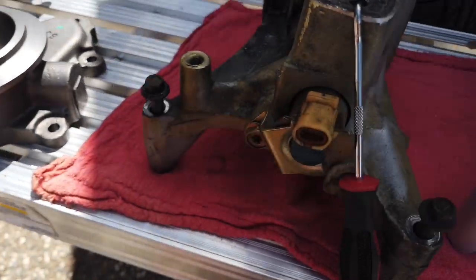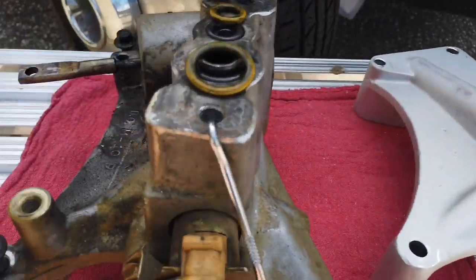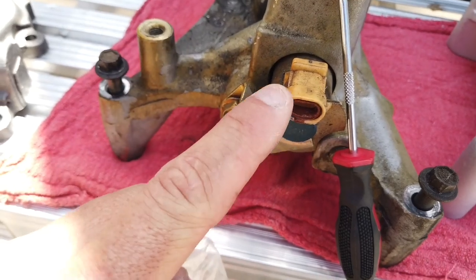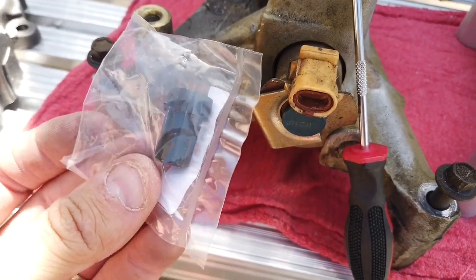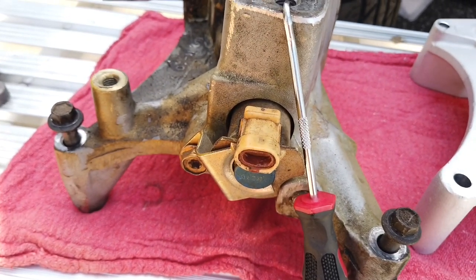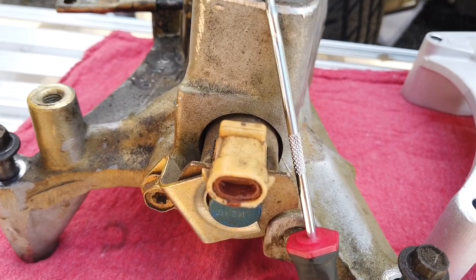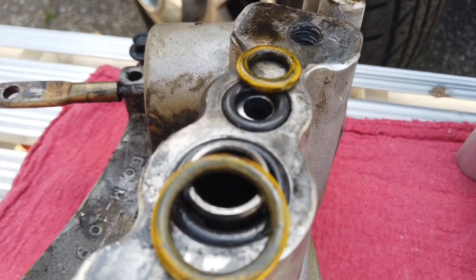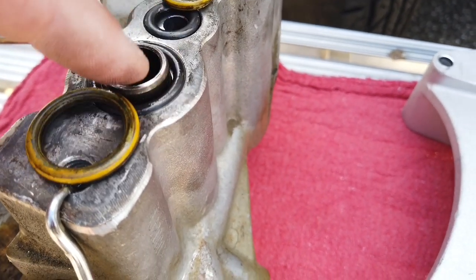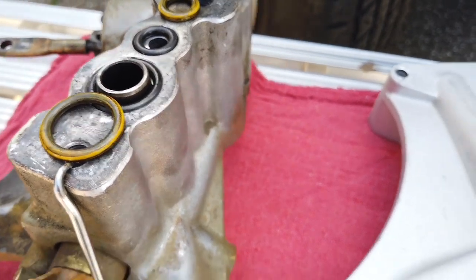with. And because this will not have the actuator, I'm going to need this little guy right here, which basically replaces this, and that plugs in to your existing harness. Basically it's like a pigtail, probably some kind of resistor of some sort, so the truck doesn't throw an engine light. These are the old rings that were on the truck. The yellow ones were on the bottom of the block, and then there's two brown ones right here. That's where the turbo sits.